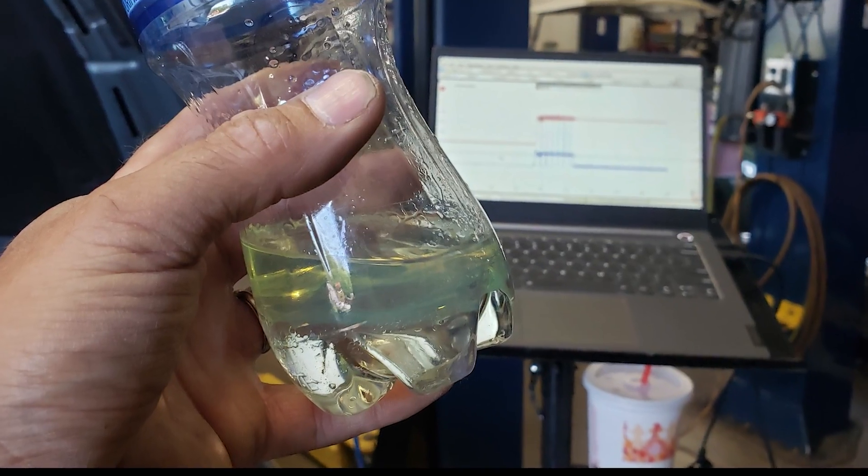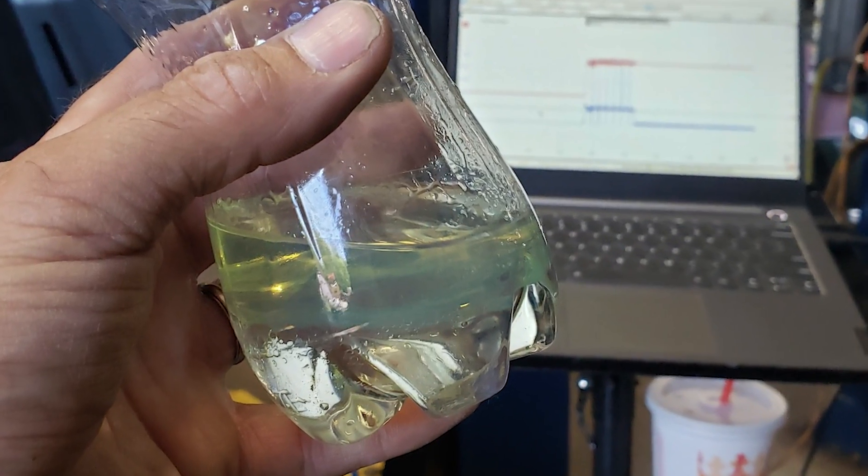We took the fuel pressure with the WPS and the fuel pressure was spot on. Took a fuel sample and it felt oily on my hands - you get it in your fingers and it just stays oily. If you spill it on the floor it would just sit there in a puddle, slippery. Usually you spill some gas on the floor, it'll be slippery and evaporate in a few minutes. But this would just go on the floor and sit there and not go away. So we got an alternate fuel source, hooked up a Motorvac machine, and it ran just fine. That one was good to go.